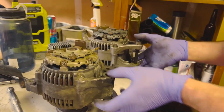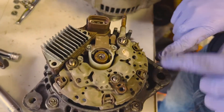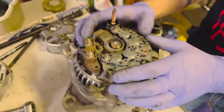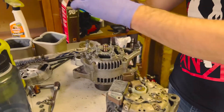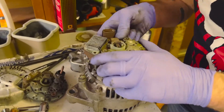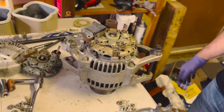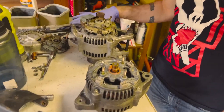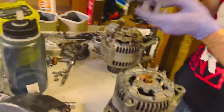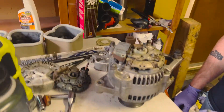You can do this swap as long as you're using the same kind of alternator, because Denso alternators use the same frame. If you look at them, they almost look the same — the only real difference is the mounting points. Looking from the top, all the points where the windings are hooked up are basically identical. They use the same shaft size and the same brushes, so we can just take them off, fiddle around to get the brushes in, and it fits perfectly.